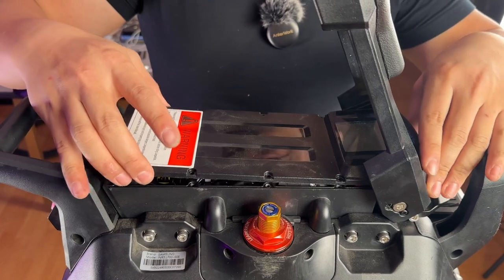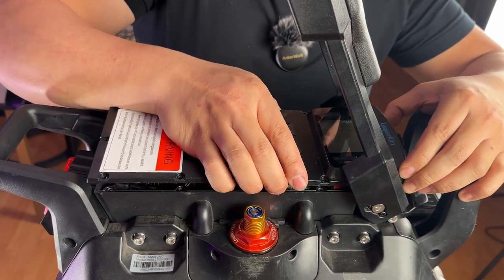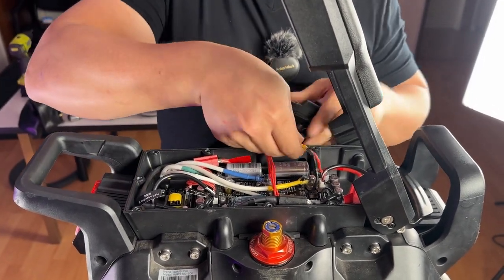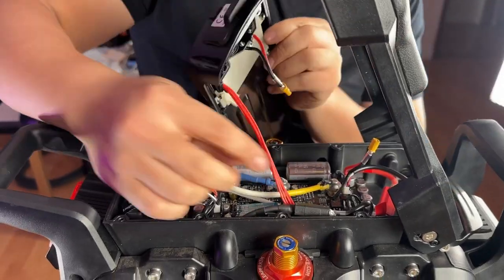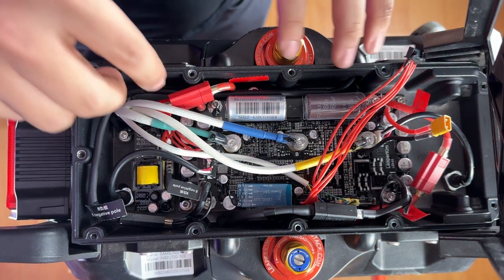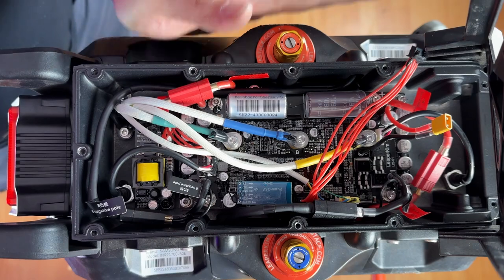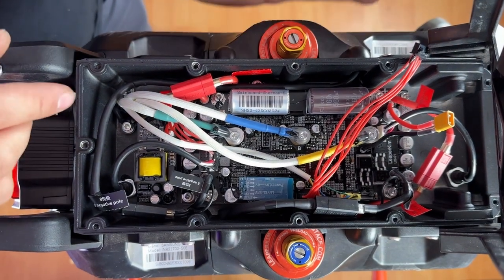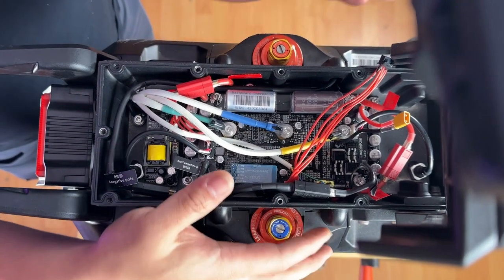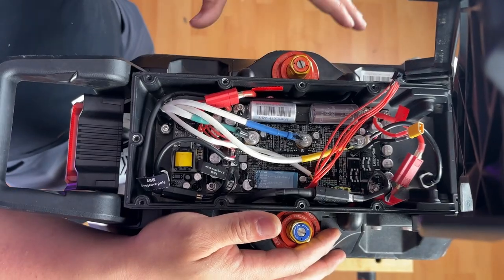Remove your control board cover — you'll want to lift it off of its perch. It may be a little bit tight but there's a way to squeeze it out, then remove the cables from the motherboard. Now that we are ready to remove the battery terminals, we only need to remove one side of the wheel — the left side. The right side has the phase wires that go through the wire trough, so by removing just the left side you can get access to the tire.